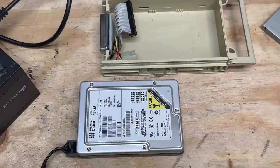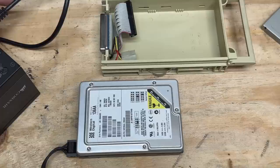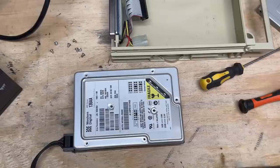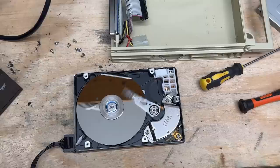Alright drive, it's just you, me, and a power supply — let's see what you got. That's not good. Clearly the heads are stuck. It's also making a pretty terrible grinding sound — it sounds like the bearings are pretty well clearanced. Let's shut it off and try one more time. I think we have a candidate for the next sacrificial hard drive. Give it a little thump — it didn't like that. Well, that sucks. I was hoping to see what kind of server this thing might have been. Let's pop the lid and see what this thing's deal is. There ain't nothing we can do for this drive — that thing is dead dead. Just listen to that spindle motor bearing. Terrible.